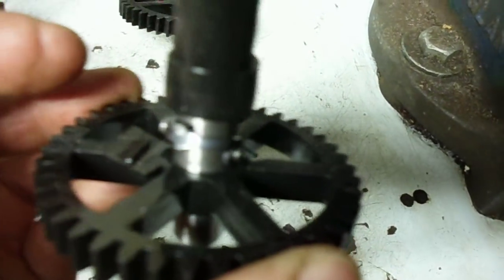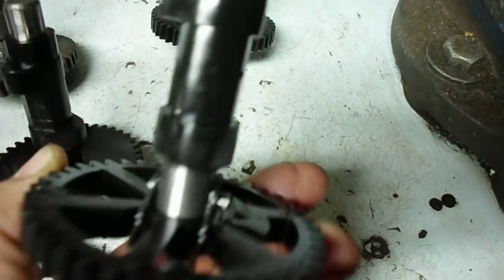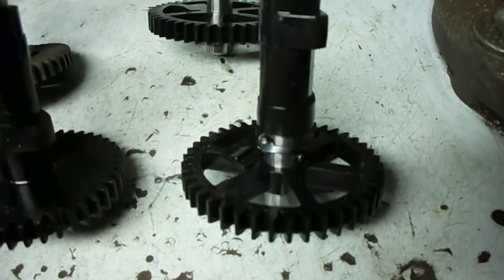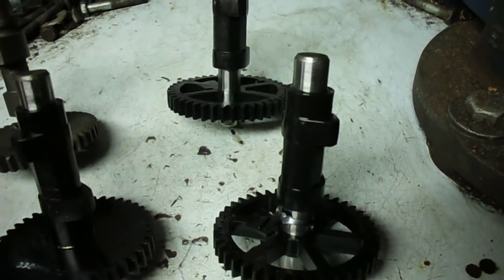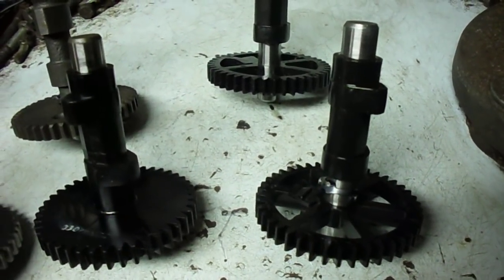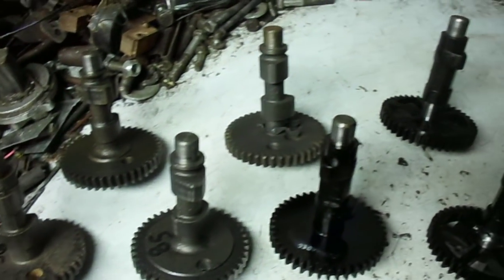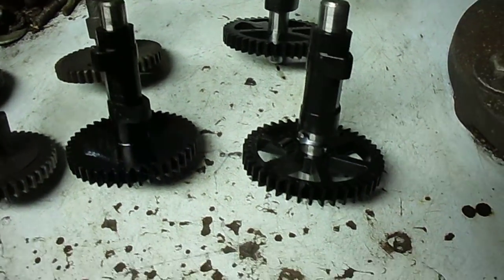It's all for emissions — that way you can run your normal emission-based camshaft profile and still get easy spin starting with the centrifugal bumper working on the exhaust. What they found was that when they used it on the intake, the engine was very hard to restart once blade brakes were introduced, probably in the mid-1980s. All that safety equipment caused restart problems, so they discovered they had to put it on the exhaust lobe.